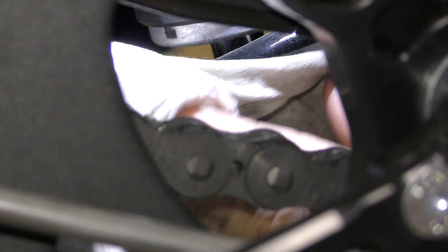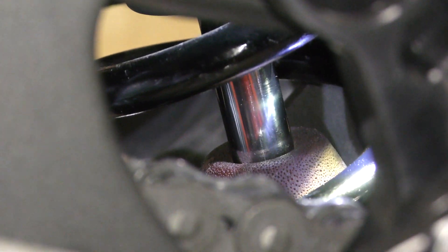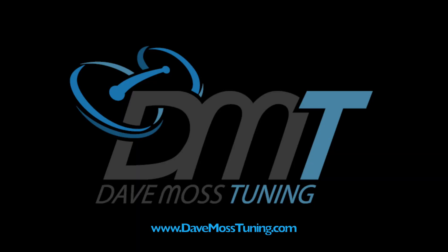Take the rag, use your finger, get in there with both sides and wipe it all down. Then take one finger to go all the way around the back so you know you've got it. Wipe around the base of the rubber bumper to make sure there's no residual there, then check it — it's clean. A couple days later, check it again; grease doesn't 100% disappear. Make sure there's no dirt line forming; if there is, wipe it down again. That should take care of it until the next time you want to figure out how much travel you're using — whether that's by putting a passenger on the back, going for a more aggressive ride on the twisties, or going to a track day.